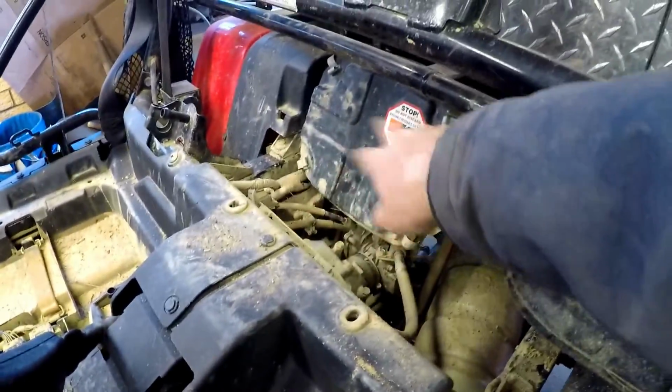My seal around my lid worked. I know people have questions whether putting dielectric grease around that to help boost the rubber seal that's around there will actually work, or should you black seal it to keep it completely sealed. I didn't get a drop of water in through my lid, so just dielectric greasing around there to give that little extra water protection barrier does the trick just fine.